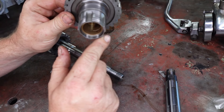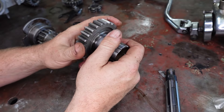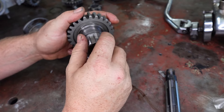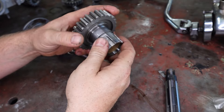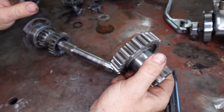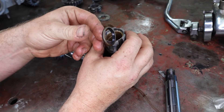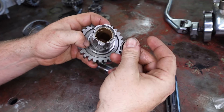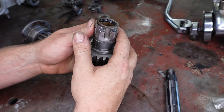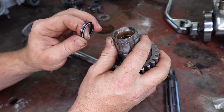You can check this in the bike if it's still together. You can get your rear sprocket and fiddle around with it and you can feel the play that it's got in there. But obviously the best way to do it is to pull your gearbox apart. Pull this seal out — this is your main shaft seal, that usually goes in the end of your gear. Pull that out because that can make it hard to determine your slop.